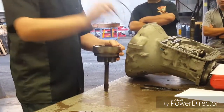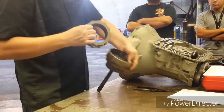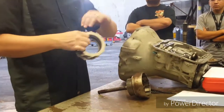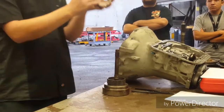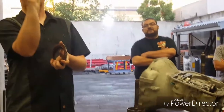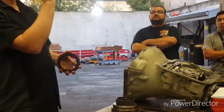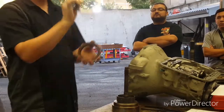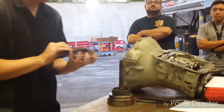Just like before, you're going to pop the snap ring out, flip it over, get your clutches out, and lay them out upside down. If you remember from the picture we were just looking at, the first one to come out — what makes it different? The thick one, right? So if they ever get mixed up on the table, keep in mind there's usually a really thick plate all the way at the end. So I'm going to pull that out and do a little inspection.